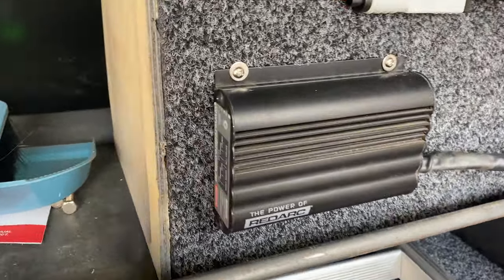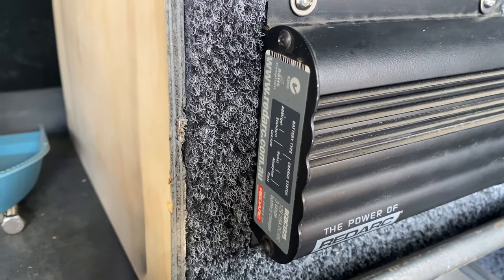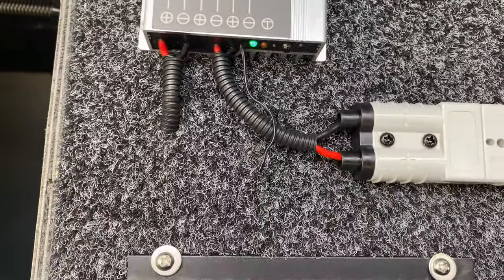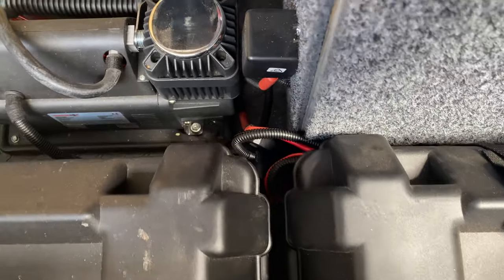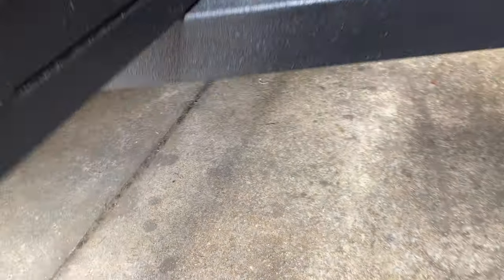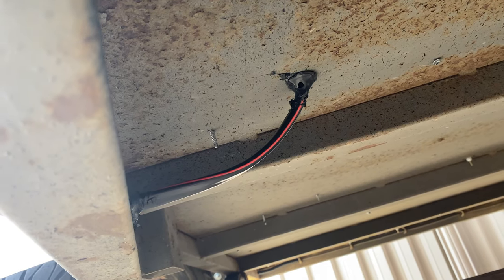The BCDC is all wired up in here. It's blinking the AGM so it's on the gel light, so once I plug it in I'll double check but I can swap it over to standard for now because I've got the lead acid batteries in there. So I've got the solar plugged in, it's blinking as well - that's putting out about 13 volts at the moment. The batteries are extremely low because I haven't charged them in ages. The cable is run all the way down tucked underneath, run through the fuses, all the earths run together, and I ran the solar with it too. Nice and neat. Underneath the drawbar here, I've run the wiring down under there - I'll chuck some split tube over that and I've just siliconed it up for now just to stop anything from coming in. Next job is to add an Anderson plug on here and then the camper trailer is done.